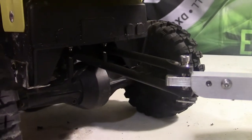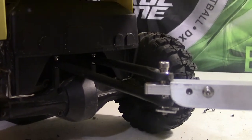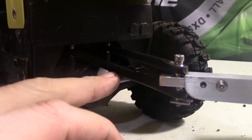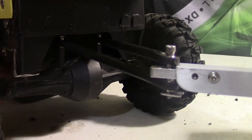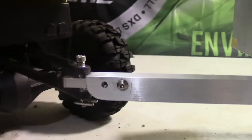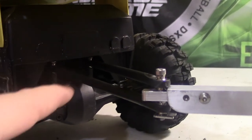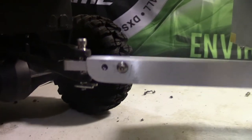Here's a quick closer look. You can see basically on top of the SCX10 axles I used those two pivot balls — the ones that go up to the independent suspension or three-link setup, whatever you call it. I used both of those, and I actually used normal stock SCX10 links, the ones that would go on the lower parts. I used both those and it helped me center the actual mount itself. Basically just put two bolts right down on top, put these on the top and bottom to help it pivot.